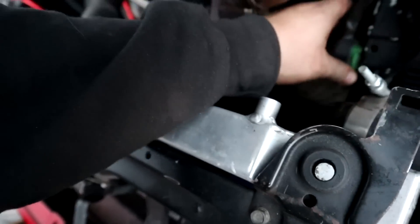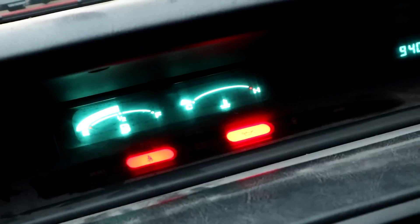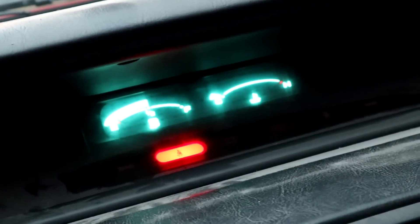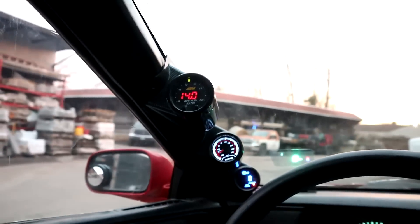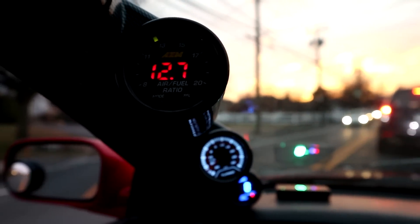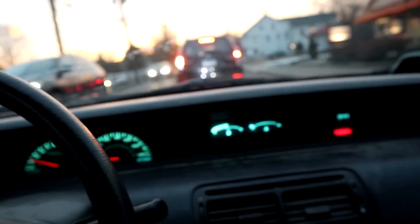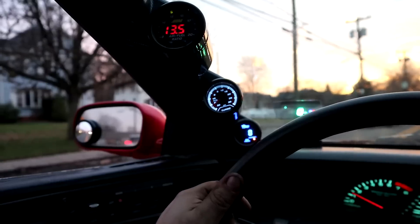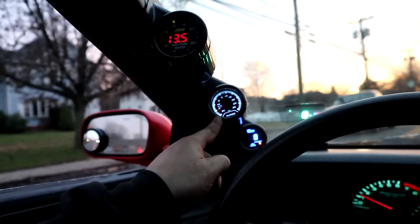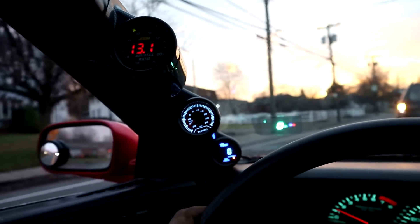Maybe that solved that. But my main issue is still the brakes. I'm gonna go drive this thing and see how it does. Oil light on the dash is on — start the car — and it's off, so we have oil pressure. But my sensors still don't work, so that's cool. My wideband is working though. This is not reading lean anymore. I believe I have fixed that problem and my brake problem because I have brakes. Now I have two working gauges. By the way, it spikes up to like 12 sometimes. I've got to get that three bar MAP in. Maybe I'll try to do that when I get back.